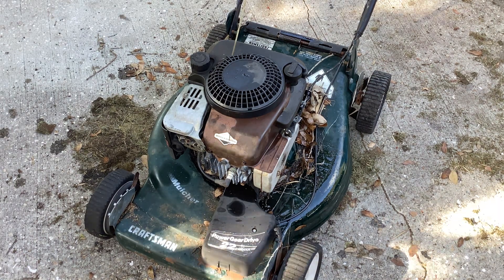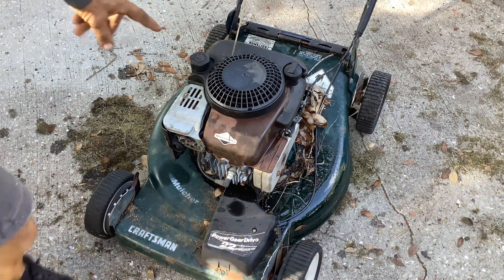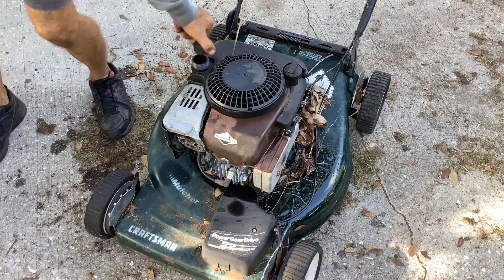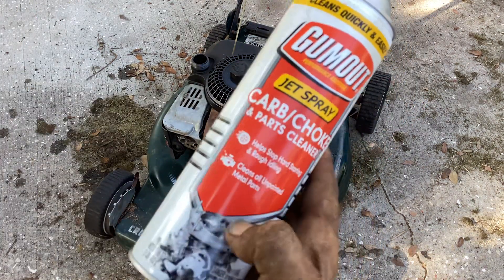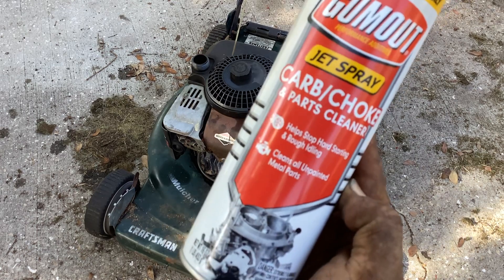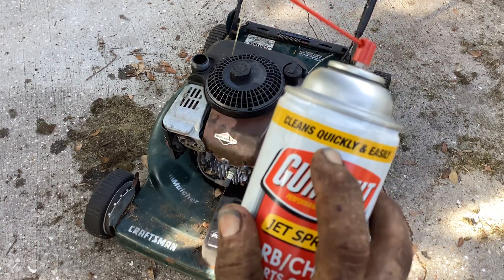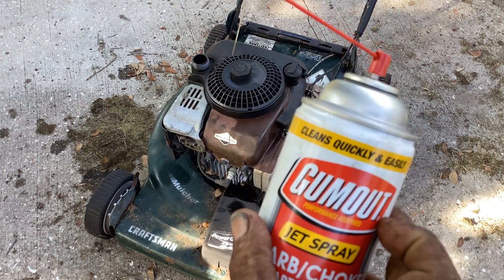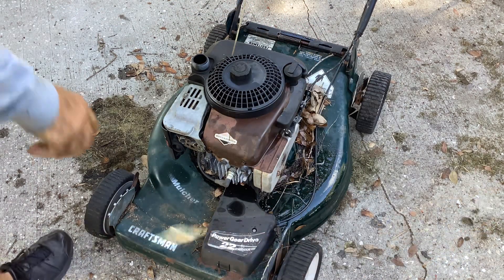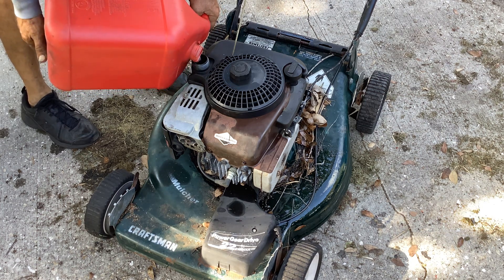It did fire off with a shot of happy juice. I put the recoil back on after I salvaged the spring and gave it a shot of motivation. Motivation 101 — it's just carb cleaner. People ask me what motivation is — it's highly flammable. You give a squirt of this into the carb, it burns off quickly, and you know you've got an engine that'll run with a carb clean. If everything goes right, you clean the carb, clean the tank, and it'll run.